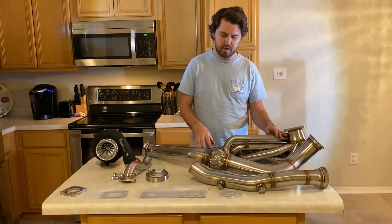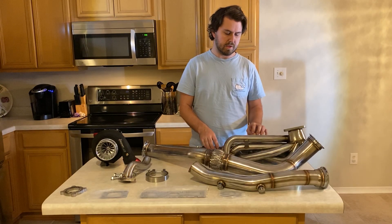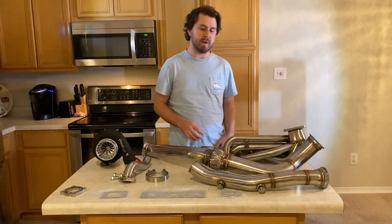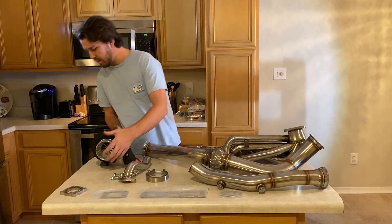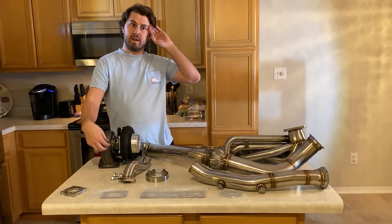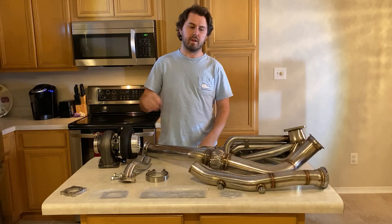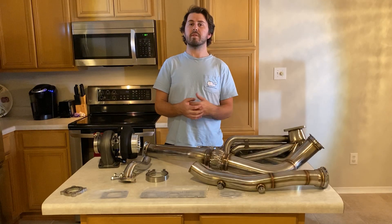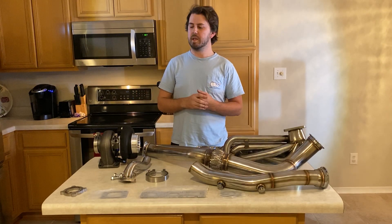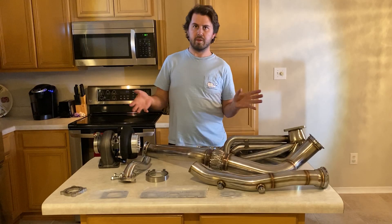What I'm going to do is chop the main wastegate runner off — that will also take a lot of weight off the main portion of the manifold — and weld a block-off plate at the collector. On the turbo's exhaust side, I'm going to weld a 44mm Tial MVR flange and run a wastegate directly off the turbine housing, also 44mm instead of 38mm, to prevent boost creep. I'm also going to run an Innovate SCG1 boost controller for its safety features, and hopefully this thing will be running over the next couple of weeks.